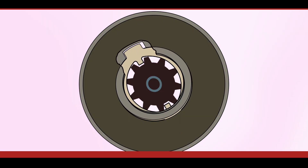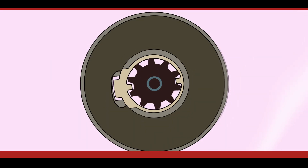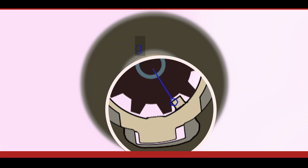These feature a hub with a pair of self-contained Belleville washers that are designed to slip after approximately 12 foot-pounds or 16 Newton meters of torque. This provides smoother engagement and protects the clutch brake from overloading or tang breakage resulting from driver abuse.